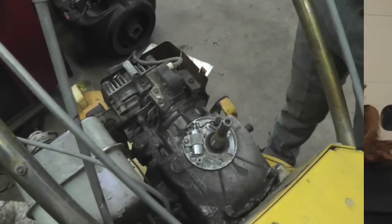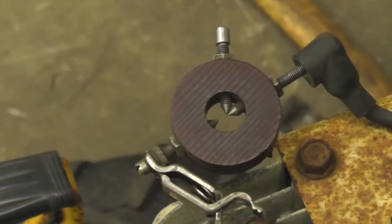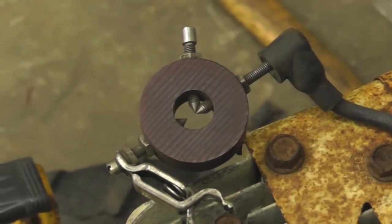Put the flywheel back on. Make sure you get that starter clutch tight — if it's not tight it's going to shear that key and you're going to have no spark again. Got the flywheel back on, got the starter clutch on there real tight, got the recoil back on, got the spark tester hooked up. Now I'm going to show you it's going to spark — there we go, sparky spark! That's how you put a points and condenser in a Briggs & Stratton engine.